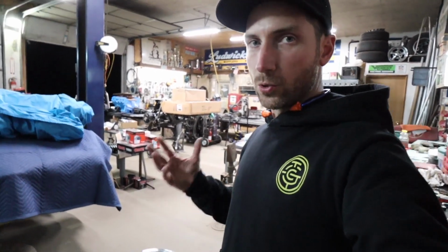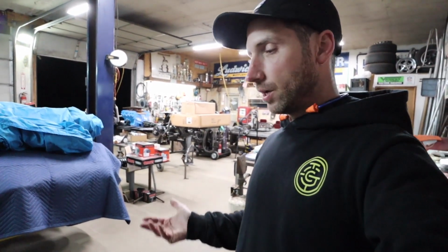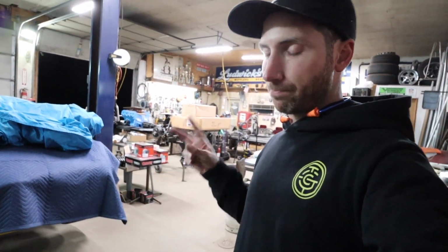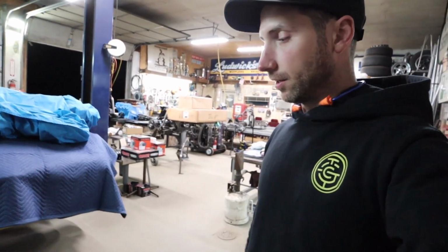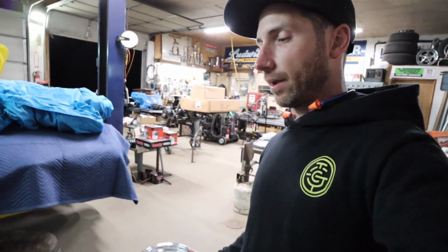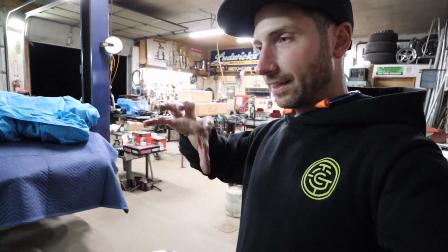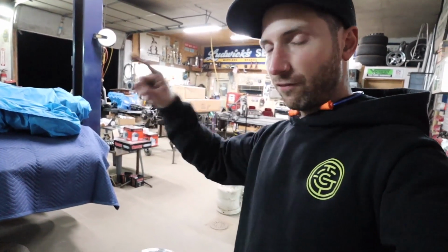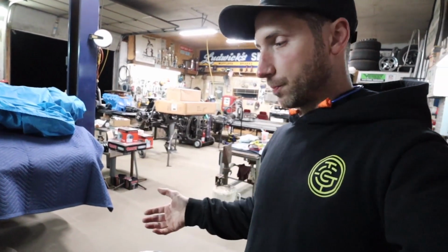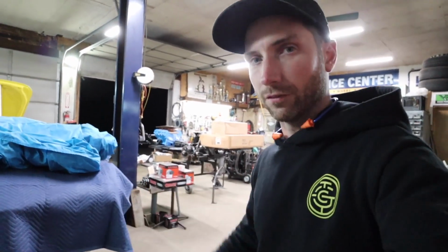These Polos, we usually see people doing 13s and 14s on them and going super low. So 15s are kind of big, I guess, for this chassis, for this type of body car. But since I'm on air, I wanted a really small tire so I could get the wheels as tight to the fenders as possible and get the tires underneath the car to have that full wheel look, but go as low as possible, but also be able to drive it super low and steer without roaching the fenders apart.